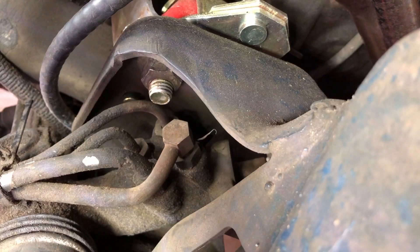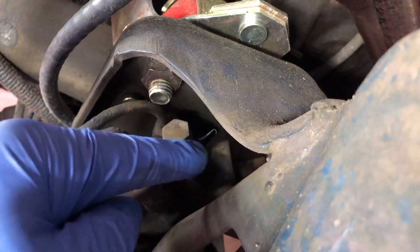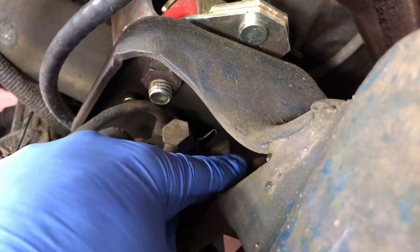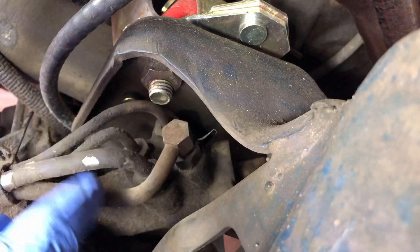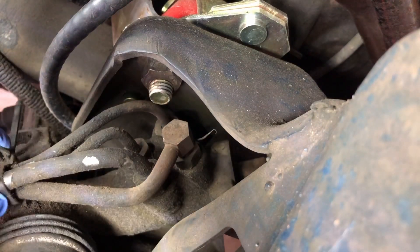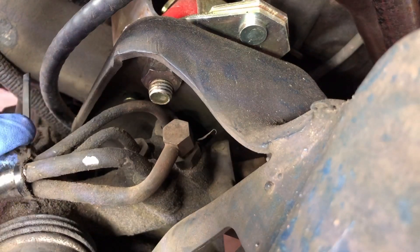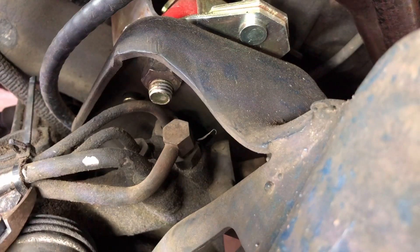Alright, I was able to get a good camera angle and some good light in here. This is the steering rack — it runs across the front of the car. At the end of the steering rack there's a piece that extends up right here, which is where your steering shaft goes in. The two lines I want to remove are this one and the one right under it. I can see there's a tie wrap on here, which leads me to believe maybe these are still the factory lines, which would explain the leaking at the other end. I'm going to cut this tie wrap off.